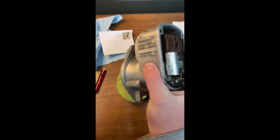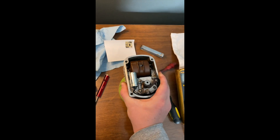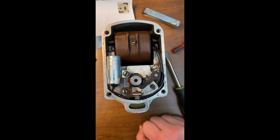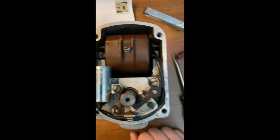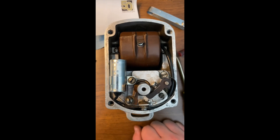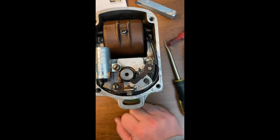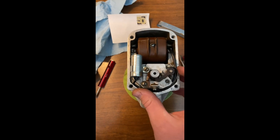On these there's no way to adjust the timing, and as long as it's not broken it's set at a standard 35-degree lag angle, so you don't have to worry about adjusting those like you did the Wico ones. For point gap, the John Deere manual said 0.02 or 0.012, but the actual Fairbanks Morse manual I found says it's 15 thousandths plus or minus two thousandths. So I adjusted it at 15 thousandths — I can't fit a 17 thousandths in there, so it's a little tight, but it'll wear in.